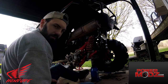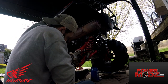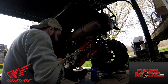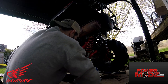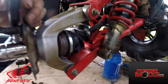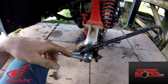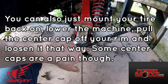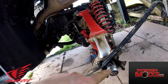I was just thinking — I have the brakes locked on and this is still turning. That means it's broken, that's why. So this is the one we broke. Undoing the castle nut is going to be a little trickier if you have a situation like this. Since the axle joint is broken, the castle nut will turn freely, so I can't back it off unless I jam the hub somehow. Maybe you guys know a better way. What I did was put the wheel nuts back on, put a crowbar in, hold it with my right hand, and pry down with my left hand to loosen off the castle nut. There you go — now you can back that off.